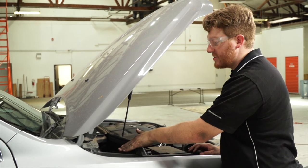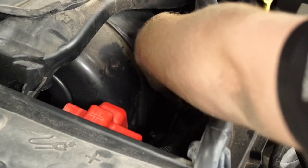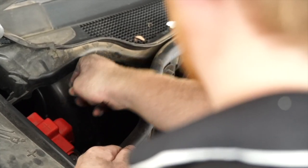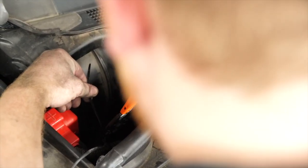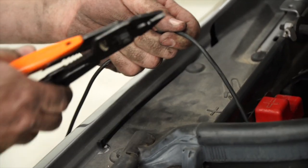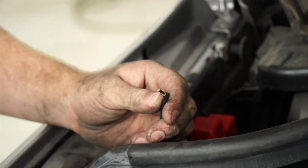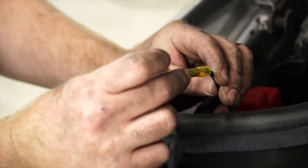On the passenger side is the battery post we'll be using. The wire loom comes right down in here, and if you reach down you'll find the end of our power wire. We'll pull it through nice and tight and secure it with a zip tie. Then we'll cut our wire and, using the heat shrink butt connector, attach our fuse holder.